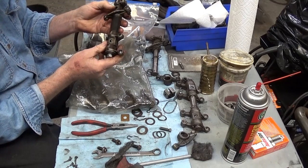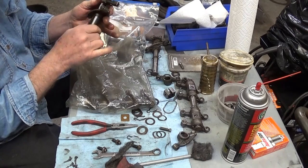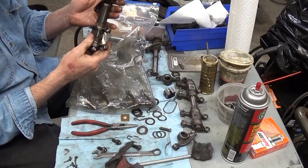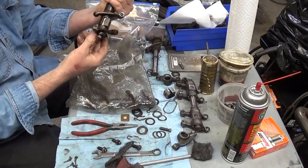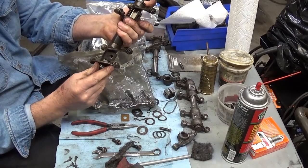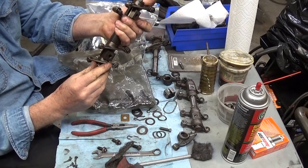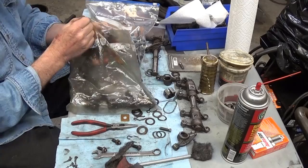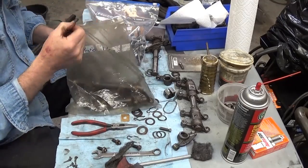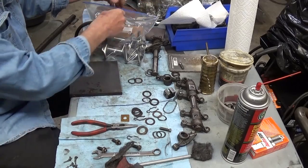That's kind of crazy. But that must have been the way it turned out. So anyhow, the thing that was nice about the Gene Berg adjusters is you could put an Allen wrench in there to adjust it. It's so much easier than using a screwdriver in a slot. So there's an example of a solid rocker shaft.